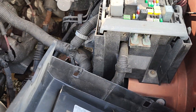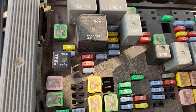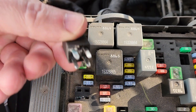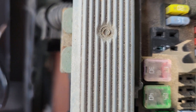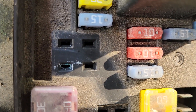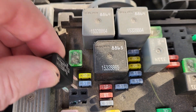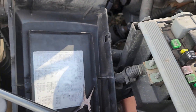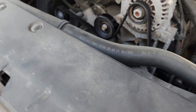I've only found corrosion in one spot in this entire main panel, and that's the fog light relay. It has one pin that's kind of schmutzed up — I'll clean that later — but that was definitely not the draw. I pulled the DIC and all that out.